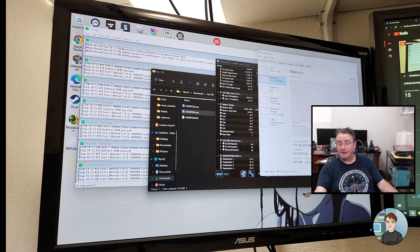Try another SSD? I mean, that would be strange symptoms for an SSD to cause, but I've seen weirder things. Okay, so if you're relying on Windows 10 to get the drivers, don't do that. Go to the HP website for the model and get the drivers from there.